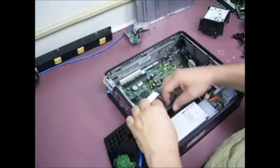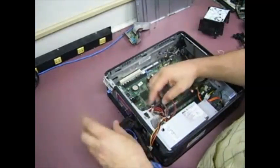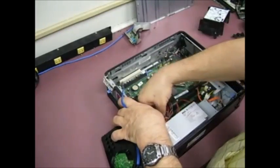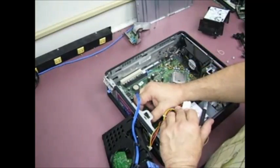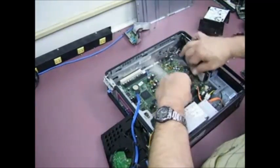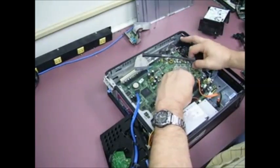Got it out. Now we need to remove the hard drive SATA cable and unplug the front panel control cable that was tied into the power supply cable. Then we should be able to do a little wiggling to remove the motherboard past the cables.